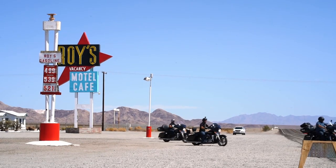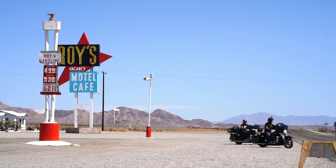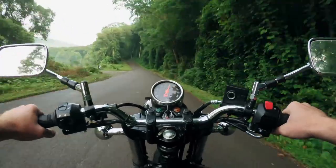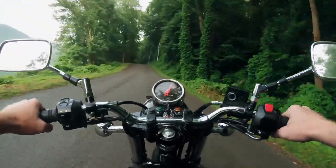For all intents and purposes, most are generally topping out around that mark. The power and torque is in the mid-range, and that's where it's wanted on most street bikes — you're there most of the time in that 2500 to 4500 RPM range. That's why low duration cams are used in most touring bikes today: they want to be able to pull up a hill with two up, pulling a trailer, passing a truck on the highway — they need that power right there.